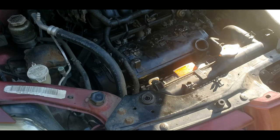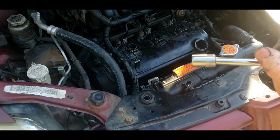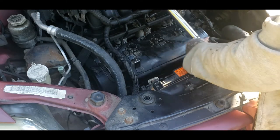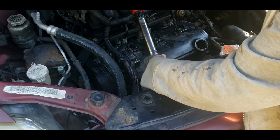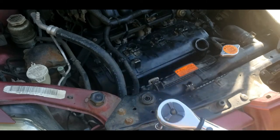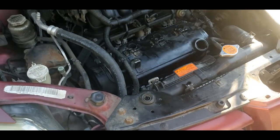Ain't very high. So since I torqued the spark plugs, I'm going to go ahead and torque the valve covers too. They torque down to 31 inch pounds. Yep, that's very light. So I'm spinning down here to 31 inch pounds. I'm going to torque these sons of guns down. So I torqued these down at 35 because I'm taking into account I got an extension on this. You got to add it up. It's math, you know. And 35 is roundabout what I figured it would be for this. Probably give or take a little bit more, but oh well, good enough.